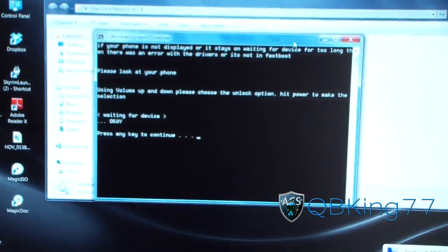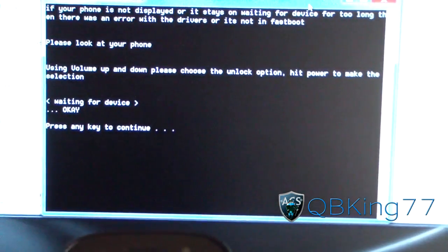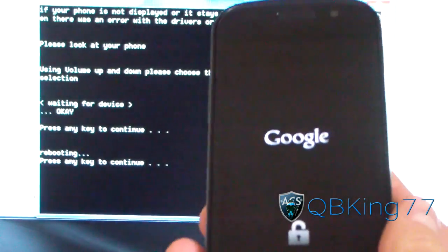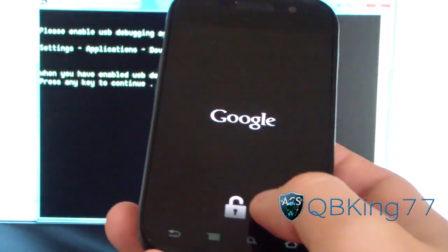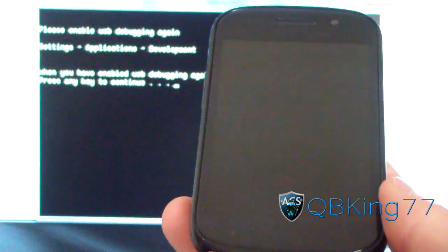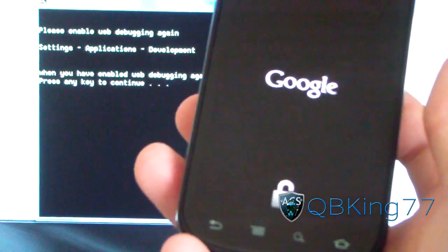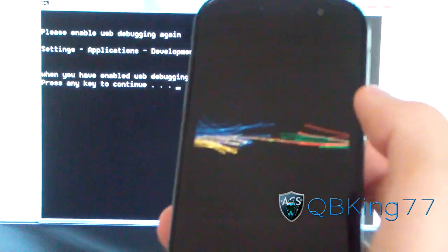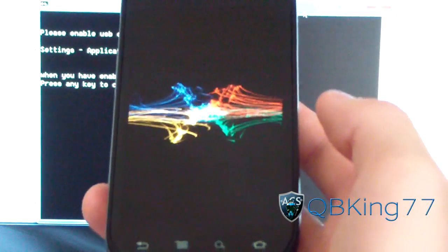And that's it — on one click it says waiting for device. Press any key to continue on your keyboard. It should reboot your Nexus S. Press any key again to continue — it'll actually reboot your phone. You can see the unlock icon to let you know your bootloader is unlocked. Everything will be wiped after this process. Just unlocking the bootloader is what wipes all the data, so anything in the future will not wipe your data. It's going to reboot your phone, and then we're going to need to re-enable USB debugging.